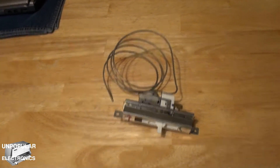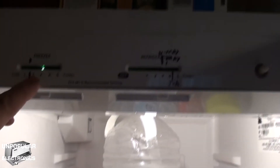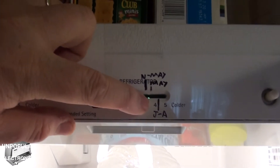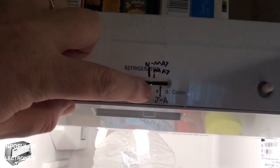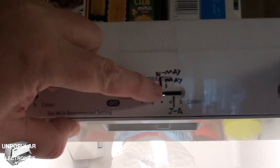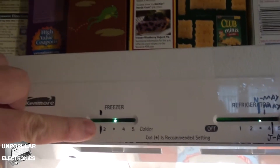Let's go over to the fridge and I'll better explain what I'm talking about. What you can see here is the freezer control. The problem I was having was that this is the normal setting — you're supposed to put it here. I like my refrigerator a little colder than that, and you can see I've got dates listed here. About June through August I had to move it down to here to get the temperature around 38, and a lot of times the temperature would dip to almost freezing. It was very inconsistent. Then from November to May I had to move it up to around here, and also move the freezer to a warmer setting.